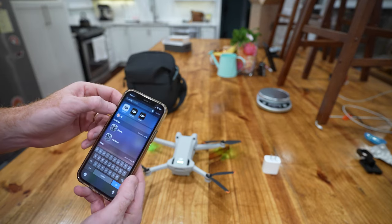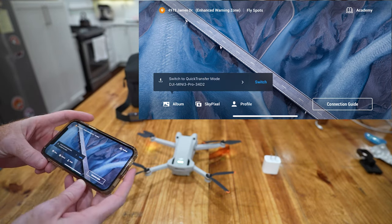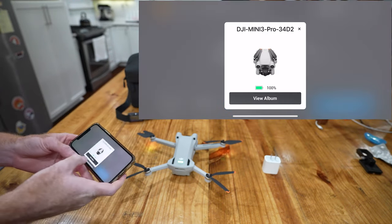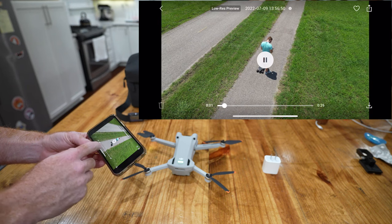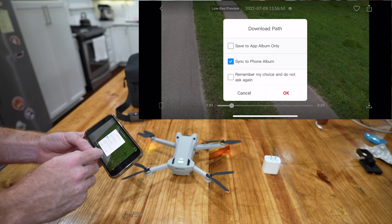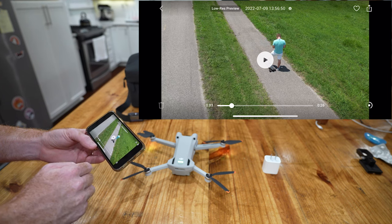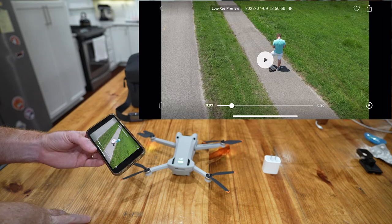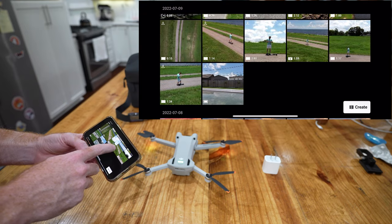You might be thinking, what if I want to get clips and images onto my actual phone? Really, really simple. You turn your transmitter off, open the DJI app on your cell phone, and it'll say to connect to the drone. The transfer speed is incredibly quick — way faster than any drone I've had before. One small caveat: the drone needs to be open to achieve those really high transfer speeds. DC Rainmaker pointed this out — if the drone is closed, your transfer speed drops by about 90%. So make sure the drone is unfolded when transferring. Generally, the quick transfer is awesome and I'm a huge fan.